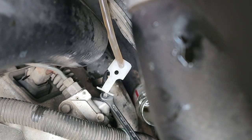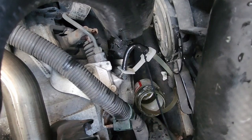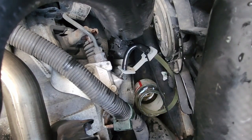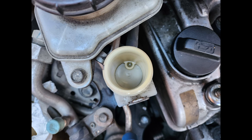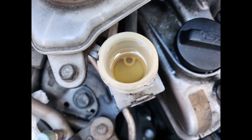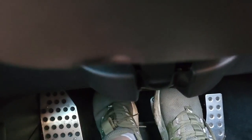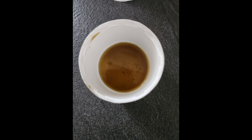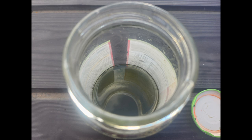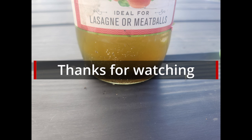Don't be worried if this takes a good bit of time. You can see the slave cylinder just starting to move there as the pedal is being pushed — push it all the way down and open it up. Eventually once you're happy, you can transfer to a normal bleeding method using an easy-bleed one-way hose into a jam jar, just to flush the system through. Once satisfied, clean it all out, soak it up, make sure the reservoir is nice and clean. Then test with the engine running, making sure it goes into gear and you've got a good bite point. This is the fluid that came out of the old master cylinder — after the vacuum process you can see deposits in the bottom, which is probably remnants of the old seals. Feel free to like and subscribe if you found this useful.